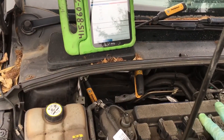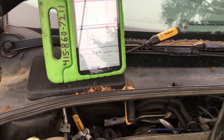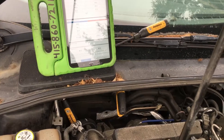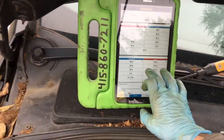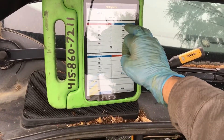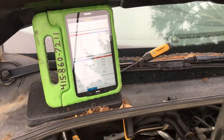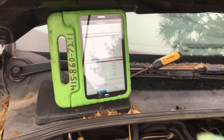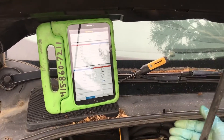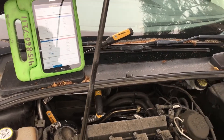All this data will go into your sales receipt to your customer. If it came in running, you could perform the test when a customer comes in complaining about a cooling problem or wanting a service. For example, say their air supply out of their dash was coming out at 53 or 58 degrees. Then you perform your AC service and diagnostic, and when finished it's doing 48 degrees — you can actually show them a before and after and an improvement that they paid for.